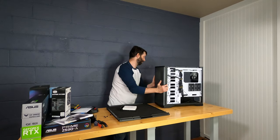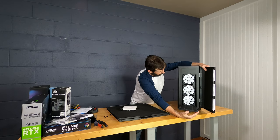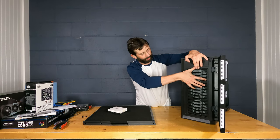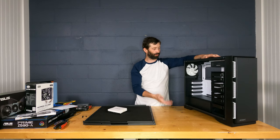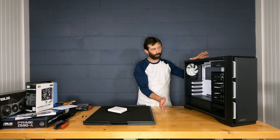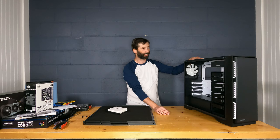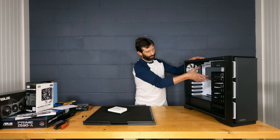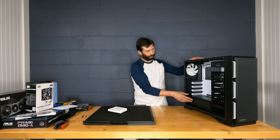There are big exhaust fans at the top, a filtered front door, and three 120mm intake fans at the front — cheap cases usually don't have filters. We're removing all the 3.5-inch bays to maximize airflow, keeping fan speeds low so you don't hear them. The Cooler Master CPU cooler will point directly at the rear exhaust fan. Once those bays are removed, we'll start fitting the motherboard.